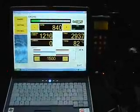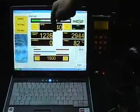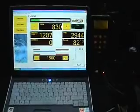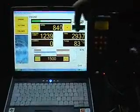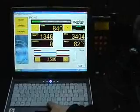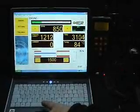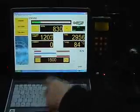Okay, so I've just been outside the car now and lifted the fuel pressure a little bit, and now we see the fuel pressure's at 1250 thereabouts millibar. We look at the fuel trim now. The fuel trim's now gone negative, and this figure is now below what it is on petrol. Just to check for you, back to petrol 33, 34, back to gas 31, 32, so it's now too rich. We need to reduce this figure.